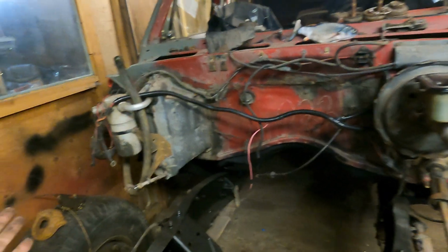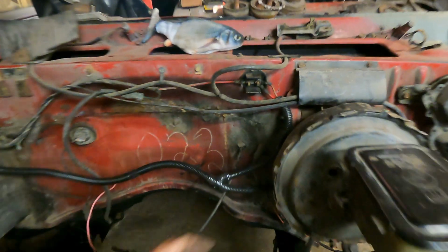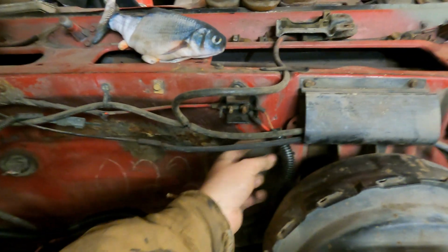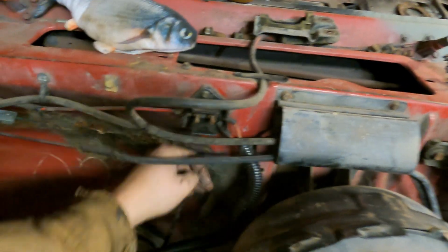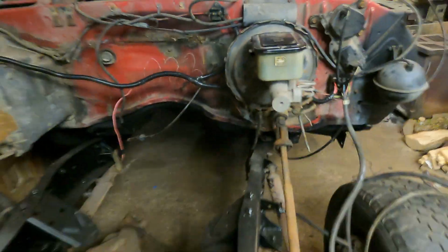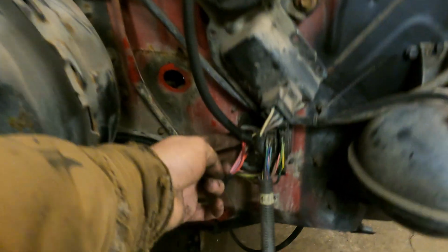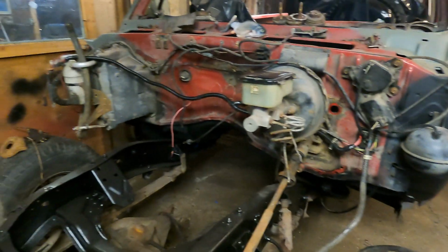Just the couple spots that, if you guys are doing this, check your wires. Obviously I had this one here. And then I had another one over here where it comes up to this terminal thing where this piece of metal sticks out, I don't know what that's for, but it was just rubbed through there. And then in the fuse box itself, I had the one power wire that comes in here. It was kind of corroded. But other than that, it went pretty good.